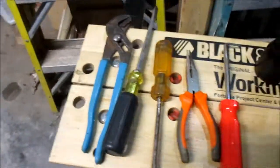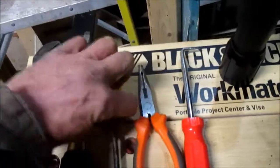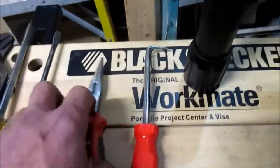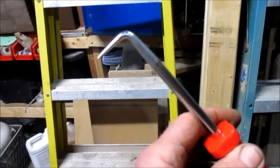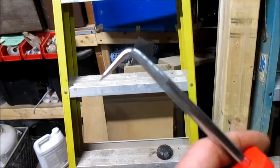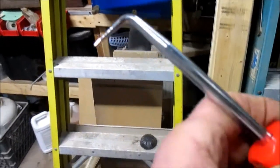I've got my channel locks here — you might wonder what these are for. Once I get the wheel off and get the old tire off, I've got to pull out the old valve stem, and that's what I use these for. Some very nice screwdrivers — I usually use these for prying the tube off the wheel. Needle nose pliers are handy. I also just purchased a pick tool about two or three weeks ago. It's super handy for pulling cotter pins and also for working heater hoses loose on vehicles.